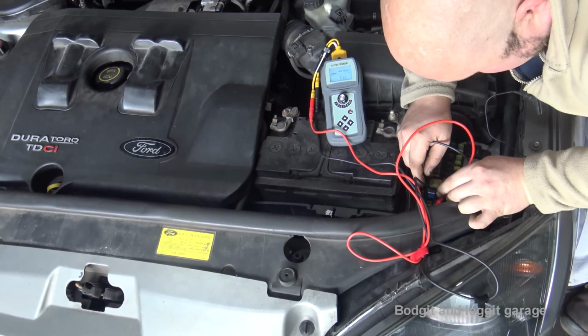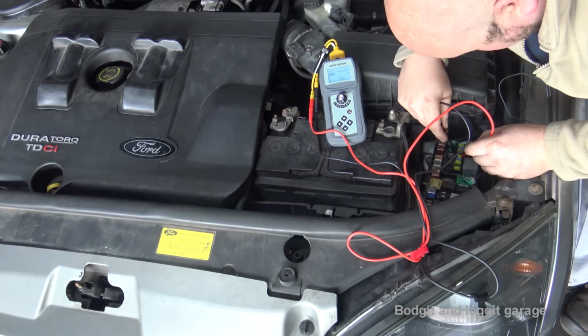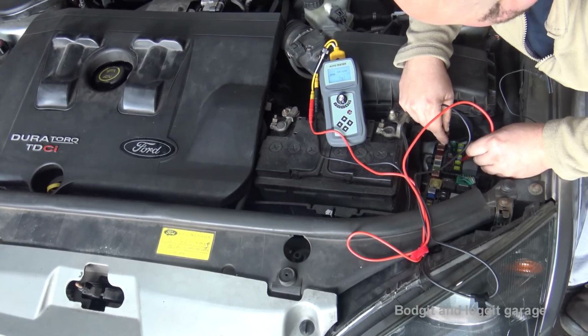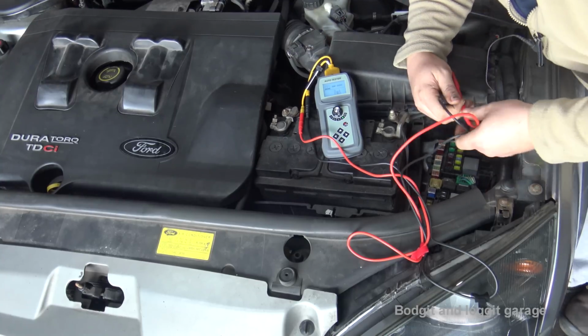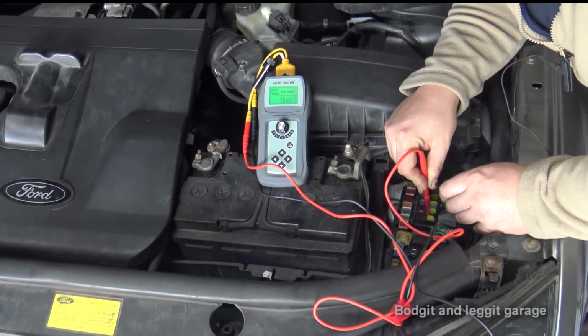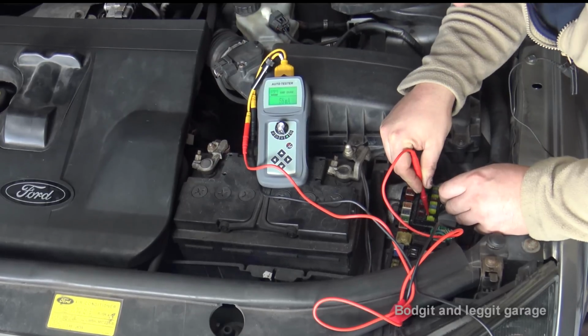which there's nothing. This car hasn't got a draw, so we're not really expecting anything on here, to be honest. But I will make a draw so you can see what it actually looks like, because at the minute we've got nothing. Now, as you can see, we've got a little draw on there. The meter's gone to green, so we know that is absolutely fine. We don't have to worry about that.